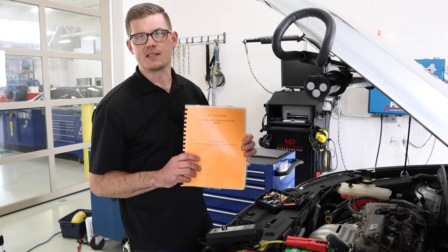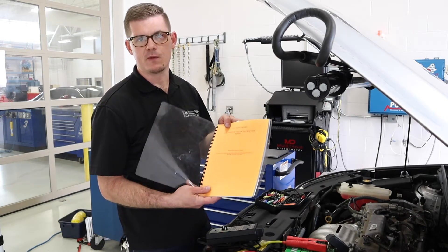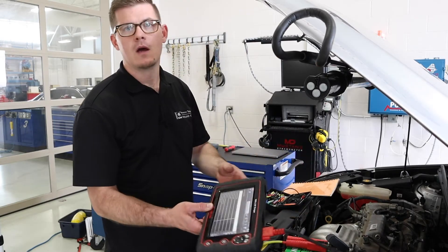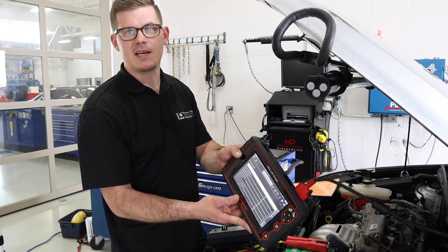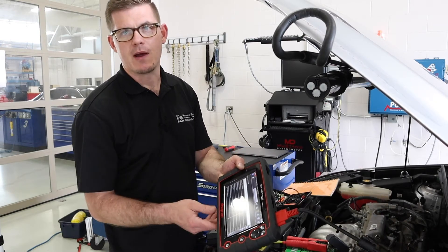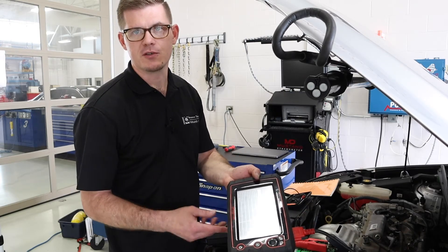The other thing I'll need is a set of instructions. Here at Parkland we made the OTC instructions into a full scale reference guide. I'm also opting to use a scan tool in this case to actuate the fuel pump, so I don't have to go to the driver's seat and cycle the ignition switch every time I want to prime the fuel pump to gain pressure.